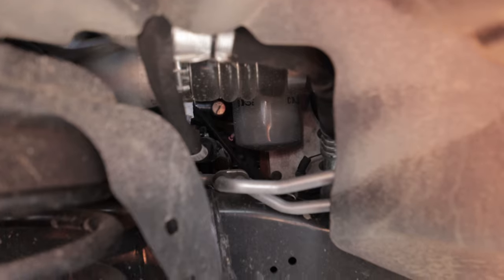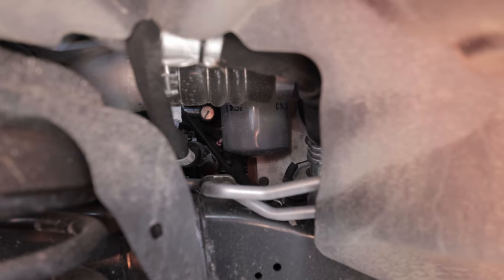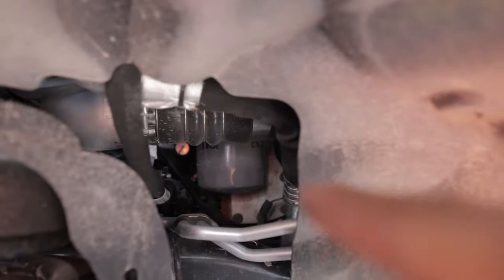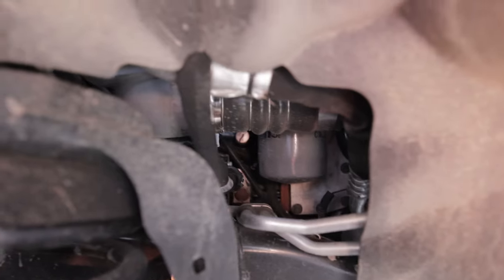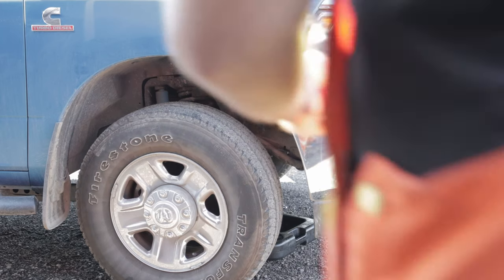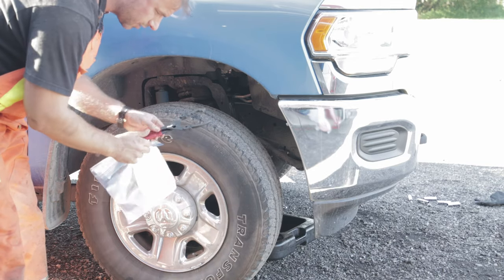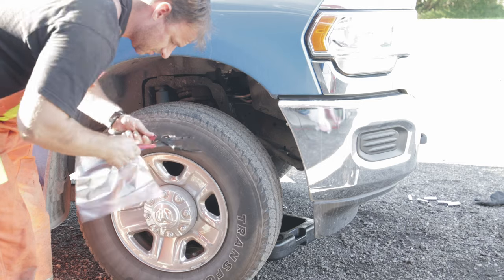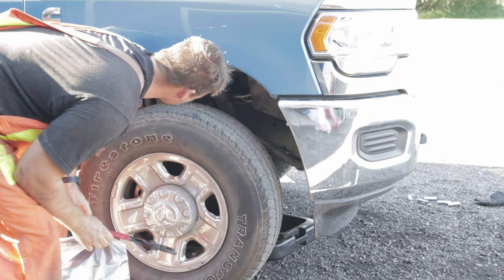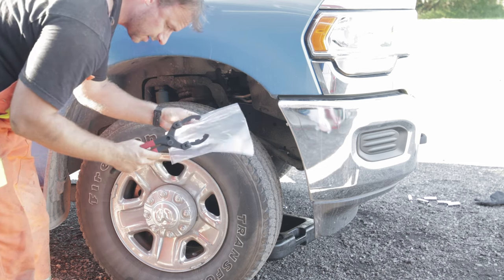While that's draining, let's have a look at the oil filter. It is kind of tricky to get to. We're going to do the plastic bag trick. You've got to pull it out sideways and put it in sideways, because there's not enough room going straight up — unless they've redesigned it. I'm using this style of filter wrench, kind of like slip-joint claws that rotate up. I'm going to crack it, and then once I get it a little bit loose, I'll get in there with my bag and take it the rest of the way off.